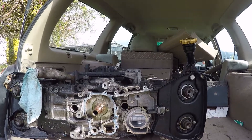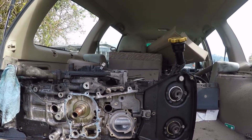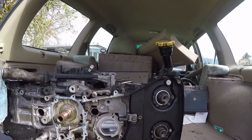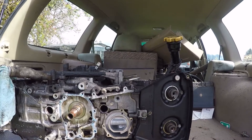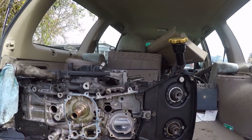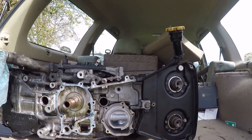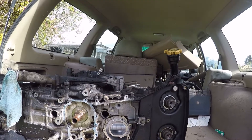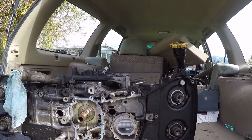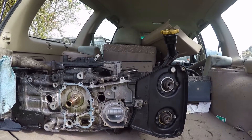All this stuff's going to be recycled anyway. What we're going to do is use a digital torque wrench that actually allows us to see a maximum torque rating that we've put on it. I'll set it for 8.9, but if we squeeze it harder than that, it'll actually record what the maximum torque that we put on a certain bolt is. On each of these bolts on this water pump, we're going to try to bolt it on, then twist tighter and tighter beyond the 8.9 spec to see how long it takes to either snap the bolt or strip out the threads such that it just starts spinning freely. We're going to record for each bolt what the torque ended up being — how much play you've actually got if you do accidentally exceed the 8.9 foot-pound spec.